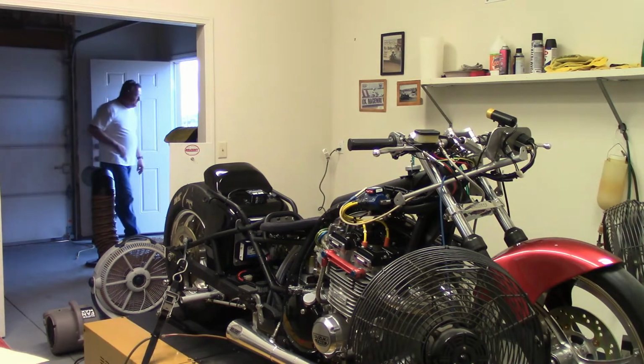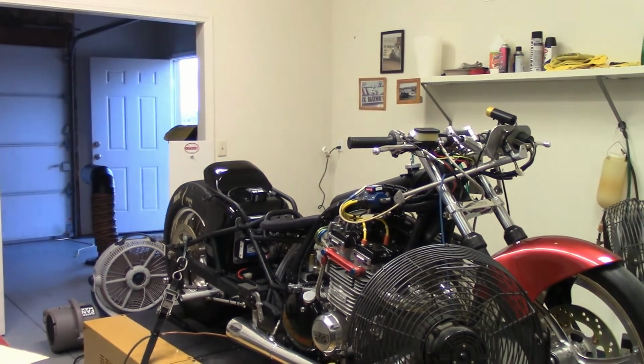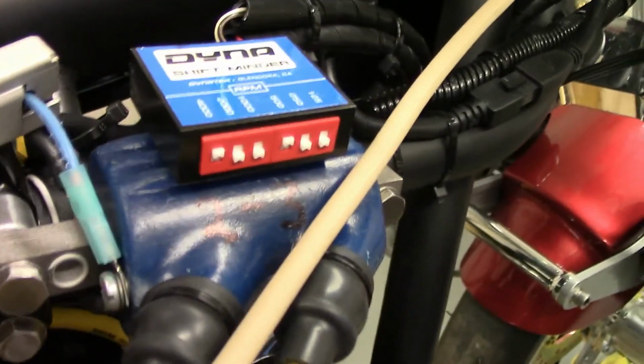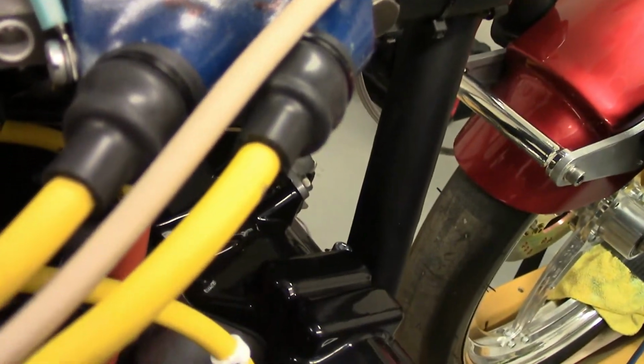Right, that was 183 horsepower with it breaking up. I gotta get out of here, open the doors. Well, just found something with the inductive pickup on the pulsing side of the coil wire where it's connected. It kind of rolled around, cut into the wire, and then this was touching on the coil.